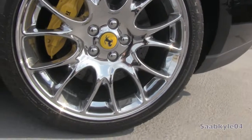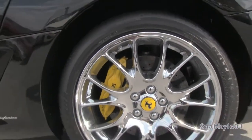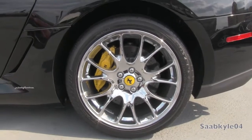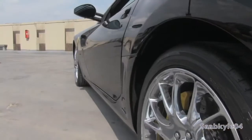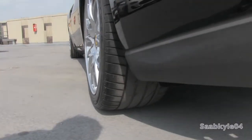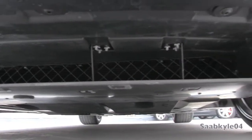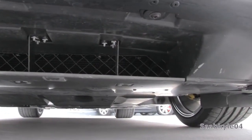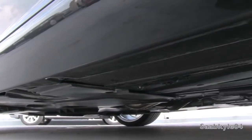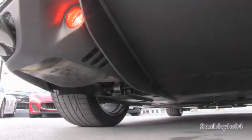As far as the brakes, the best performance was provided by these optional cross-drilled ventilated carbon ceramic Brembo brakes, measuring 15.7 by 1.4 inches in front and 14.2 by 1.3 inches in the rear. These brakes, costing an additional $18,550 when new, provided superior durability and resistance to fade in high-speed, high-demand scenarios. Stopping the 599 from 60 miles an hour takes an impressive 105 feet.